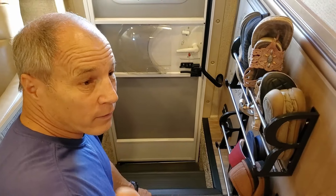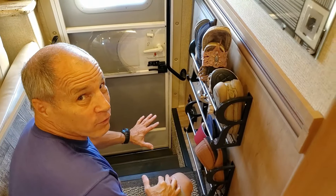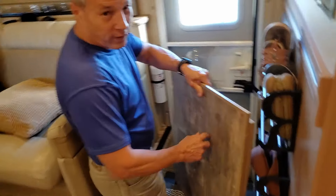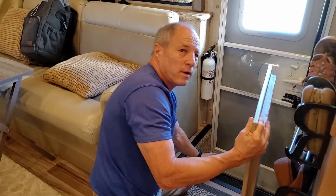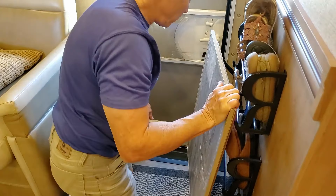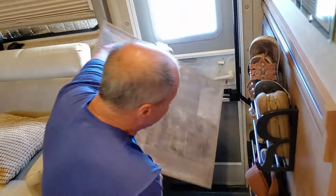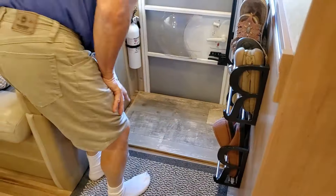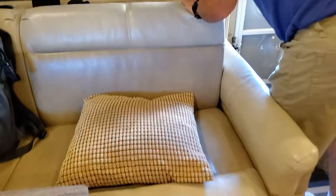As we're traveling, this area is all open, and when people walk by there's a tendency to want to fall this way — it's a fear thing, thinking you're going to fall down the hole. I made this cover and put insulation on it, glued it, painted it, and everything to match. It's just floor tile that matches pretty close to our tile. We put this in here not just to cover the hole from people falling in, but also because under these steps is all open — you're open to the ground. The batteries are all underneath here, so if it gets cold outside there's a lot of cold air that comes up. This cover also helps insulate that. We just store it right back in here when not in use.